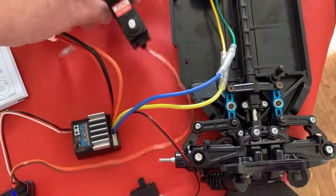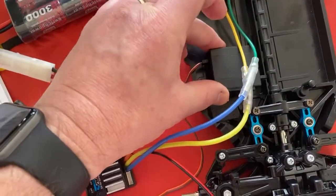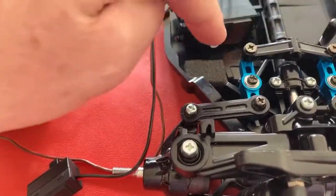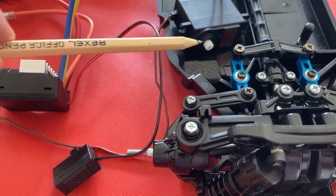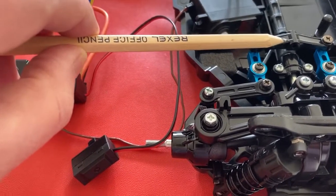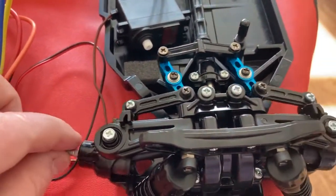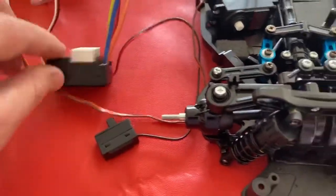The servo itself will mount into the car. So we've got to do the next process. That's going to mount here with some mounting devices into the car. And then we're going to put some arms across here, and those arms will connect between the splines of the servo to this position on the bridge of the arms of the steering mechanism. So as you turn the servo, you'll get your action to turn your arms. And that's simply the radio gear and how you connect it through.